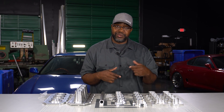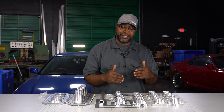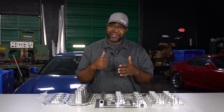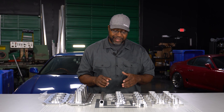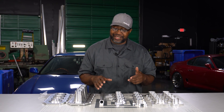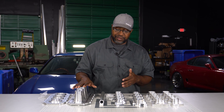We don't machine the rails with spacing and stack height pre-set because we want to keep costs down, and it is a DIY — whoever is already welding this together can handle that step. Injectors come in about 60mm, or 43 and 48mm in height, plus other variants — that's why we don't send spacers. You'll cut and set up spacers based on your injector length. Some guys have seated spacers on the base, some have different hats on top — too many variants to manage, so I give you the basics you need.